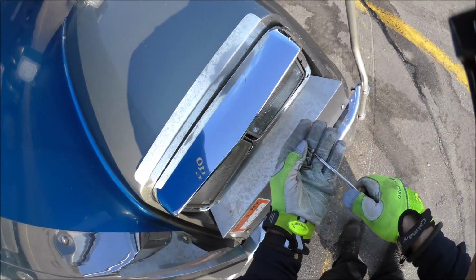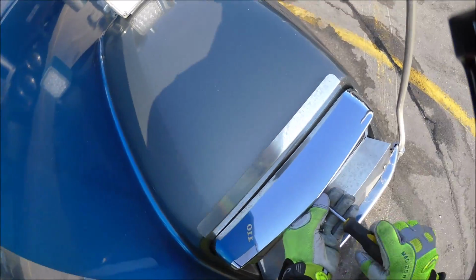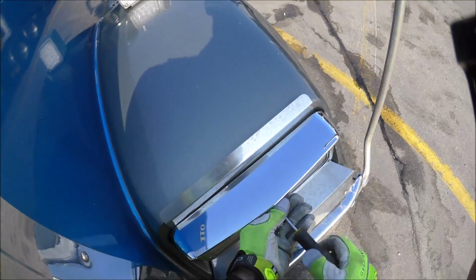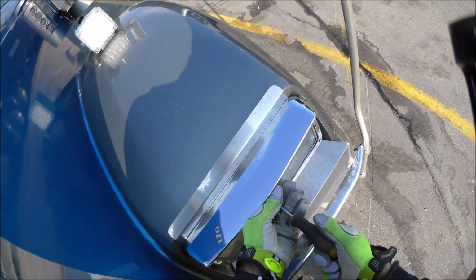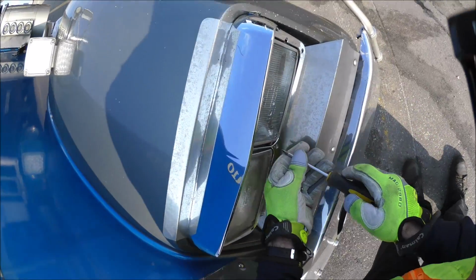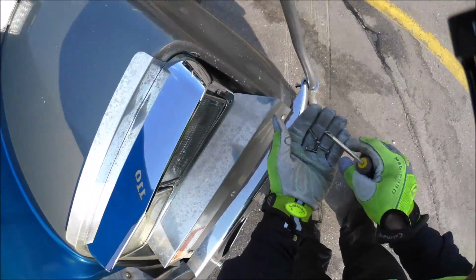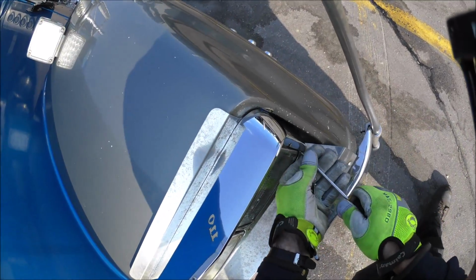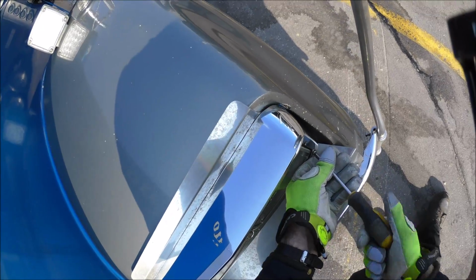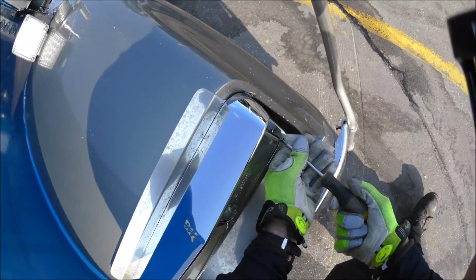It's better to do it in springtime. Get it all done before May because it gets really hot out here. All the polishing should be done in spring and fall. The fall itself is all about waxing and really covering things up, especially your rims and aluminum. You can really wax them up. Alcoa has a really good spray for that, and it'll last for a good month or so. You realize you gotta cover everything up.